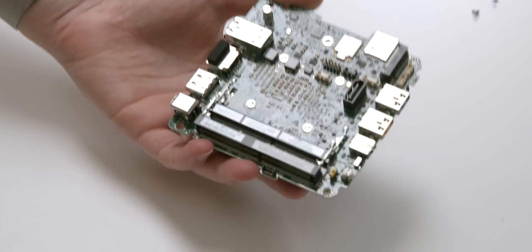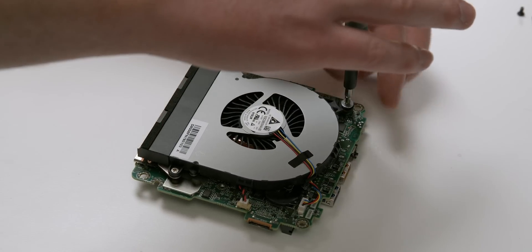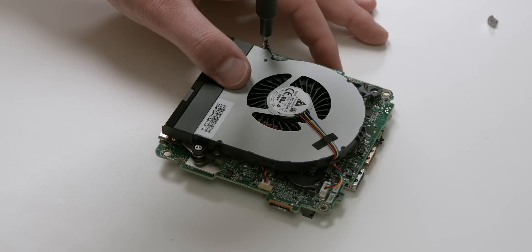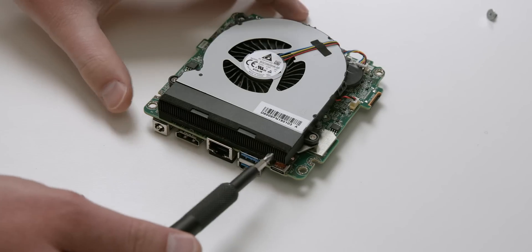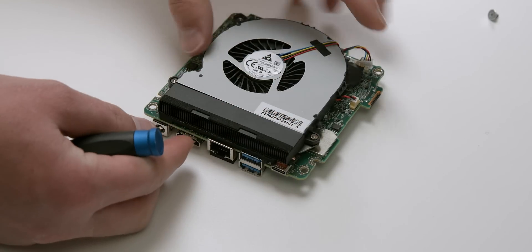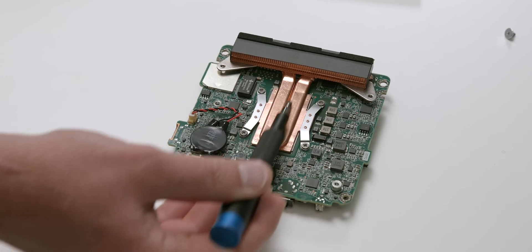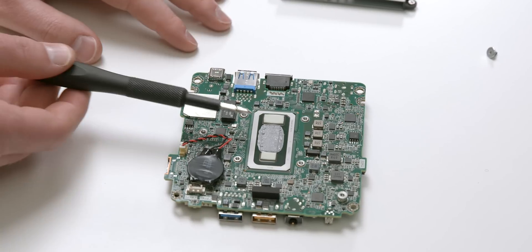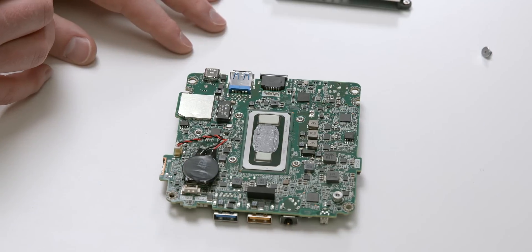Now that we have this cute little motherboard removed from the original case, we ditched the original case and antenna, and basically only salvaged the little dual microphone cable assembly and, of course, the motherboard itself. We have the CPU cooler on top — it's a blower-style cooler with a fan and an air intake. Air gets sucked into the fan and exhausted through a radiator on the back. We unplug the fan header and pull this assembly right out. You'll see copper heat pipes touching the actual CPU die. We don't need any of that, so we're removing this entire assembly. There's thermal compound on the main die but not on the two extra ones — when we put this in the new case, we'll apply thermal compound onto all three sections.